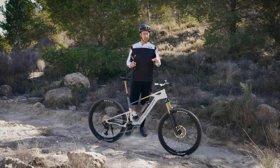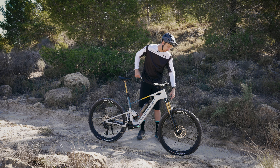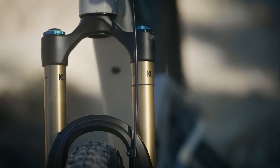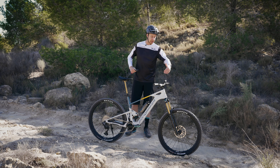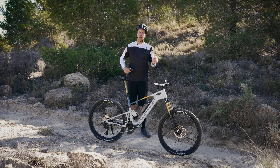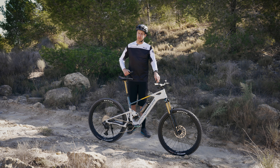For taking the actual reading, it's really important to check that your bike has O-rings on the shock shaft and on one of the fork legs. On a Fox fork, it tends to be on the left-hand leg as you look down from the rider position. As you sit on the bike, you set the O-ring against the seal, get off the bike, and measure how far it has moved to calculate the percentage. If your bike doesn't have an O-ring on the fork or shock — check both legs, it could have perished — you can use a cable tie to achieve the same thing. Just make sure you remove it after setting up, as it could scratch the fork legs. Take the greatest care possible to avoid scratching the stanchions, as that can affect performance.